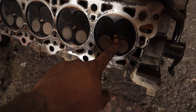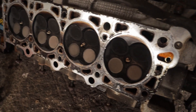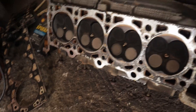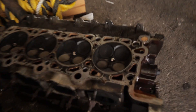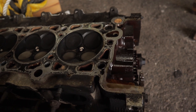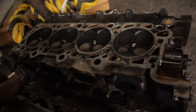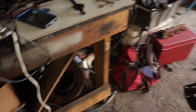So we know we weren't getting enough fuel, or the map wasn't right or something like that. But with the intake side, they are black, which makes me believe we had some type of air leak. We had the same scenario on both heads — running lean on the exhaust side, meaning the mixture itself was lean, but for some reason it was also dumping fuel. It's kind of puzzling, but we can chalk that up to just not having the right tune on the ECU for those heads and those cams.